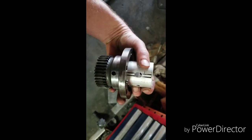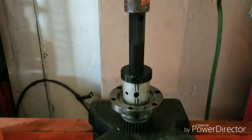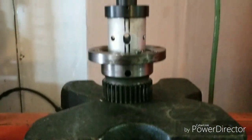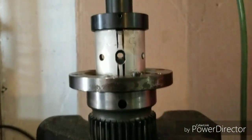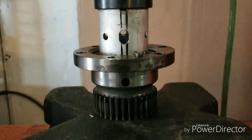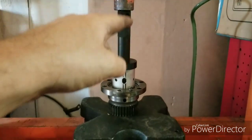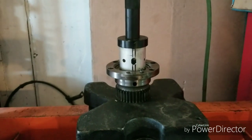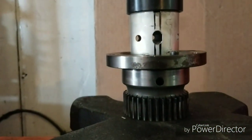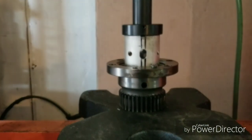Sometimes I'll put a little bit of anti-seize or lube on that leading edge. We're all set up for the press-in — with the Mazda factory tool you can actually see right through those alignment holes to the set screw hole or gallery hole, assuring everything's lined up. Make sure to take your time and set this up really straight; you don't want it to cock over or have any misalignment, or you'll damage your bearing. Take your time and press it in down to flush using the Mazda collar.